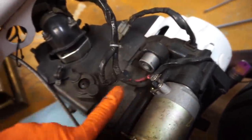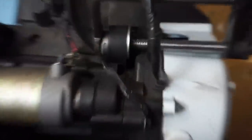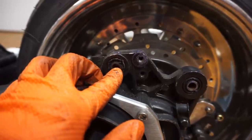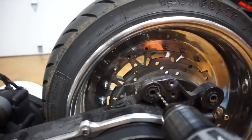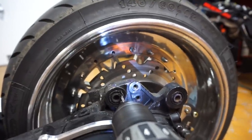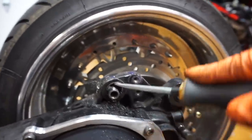The other side is done — but it has to come in from the inside because it'll hit the engine case from the outside. You can always unbolt it, but that's what needs to happen. Now I'm working on the rear shock bushing. This one was bad enough that the collar almost just fell out, so I'm going to put a drill bit in there and work it until I can get the bushing loose enough to cut out and remove.